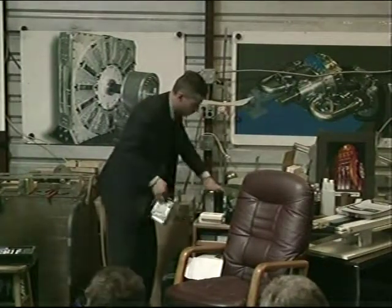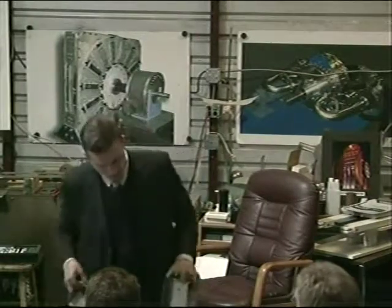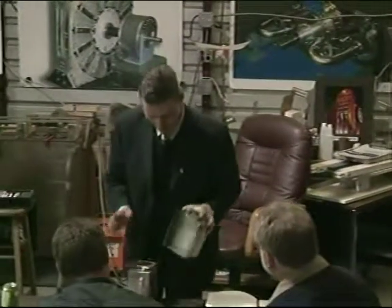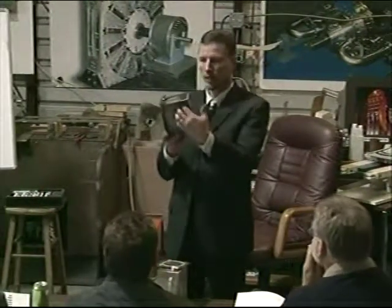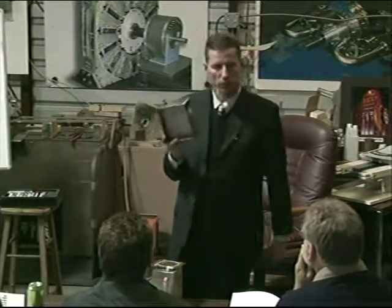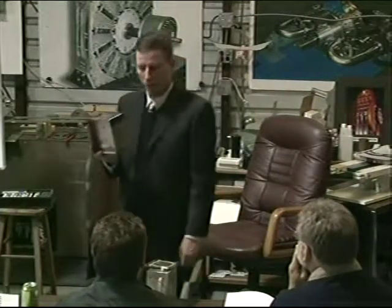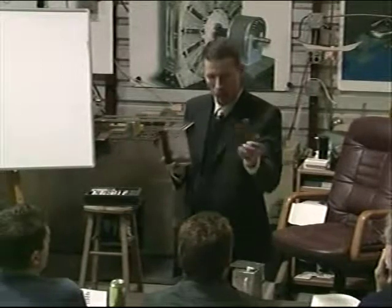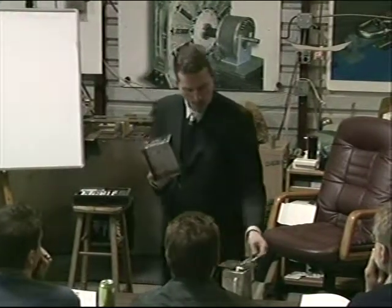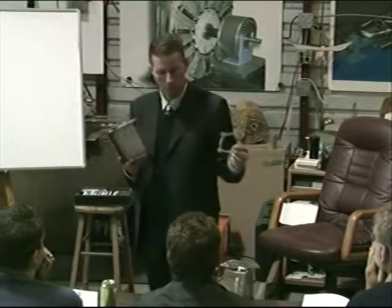These are the old fuel cells, and these are still being shipped. So I say old, that means there's something better in the works, but this is what's still being shipped. You look inside here, there's this plate. There's four threaded holes, a small hole in the bottom, and a little bit bigger hole in the top, all right? The four threaded holes are going to be to mount the plates in here. The plates are spaced apart with this plastic, and then there's a rubber O-ring that goes inside of here.